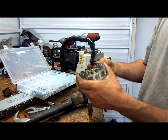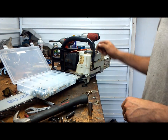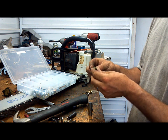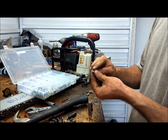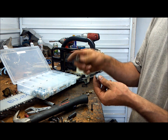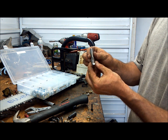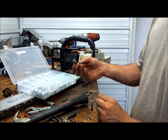You can make one of these for basically anything, new or old. Just take your nut off the end and then go to the hardware store — I keep them all around — but get the right thread pitch and right size. Run it down on there and make sure your crank actually sticks out past the hole, because when you tack a piece of shaft on you want it to bottom out on the end of the crank. The thread and the nut will protect the actual crank, and then this rests up against the end of the crank so you get a good nice tap out of it.